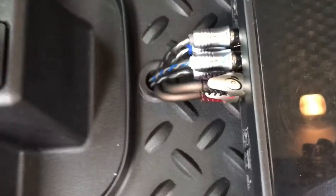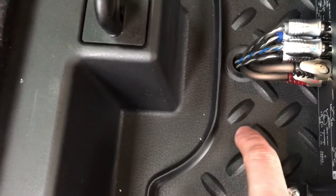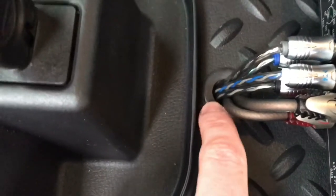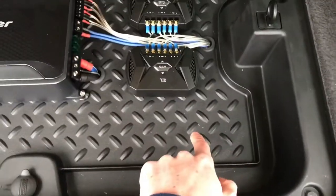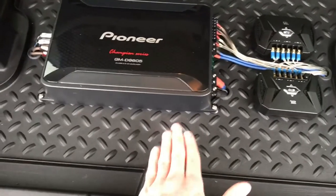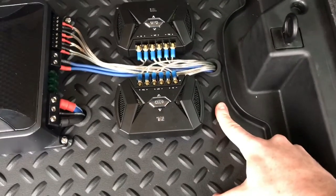This is where I ran my RCA cables. There's a three-quarter inch grommet that I drilled — when you drill the grommet, you want to drill straight in the middle of one of these ribs so the grommet has a lip to go around. There should be one of these little ribs right there but I drilled it out completely. I would suggest putting these grommets on this side because, as shown in my Lost Jeeps article, there are square ridges underneath the cargo bin that support it and keep it from bending under pressure. If you drill the holes right here, you're on the outside of those ridges, so you don't have to cut out any of the ridges to run the wires in.